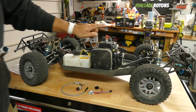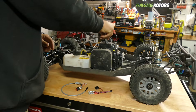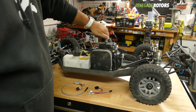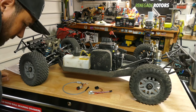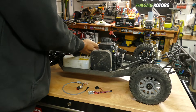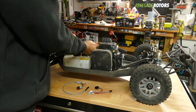We're going to try and follow what RCSparks had done several years ago, which was to just take off this shroud right here. That's basically only one screw to remove instead of having to take out the whole flywheel and everything. We're going to start by taking out the spark plug — there's one screw on here, looks like a standard Phillips screw, so I'm going to grab one of our screw guns.